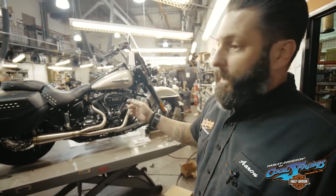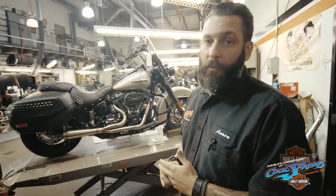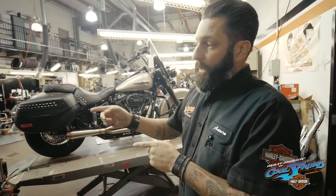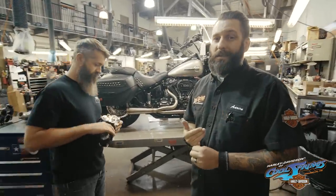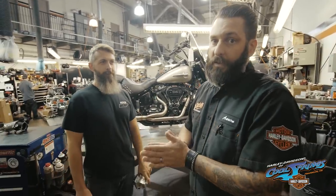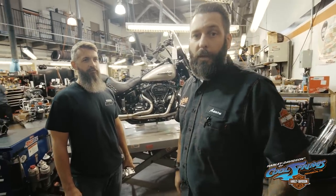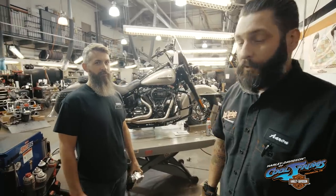Now if I were to take this pipe and put it on the bike that's sitting in the dyno room, that would not fly — not even close. Might look cool, but it's just not going to work. That bike sitting in the dyno is a 117 cubic inch, high compression build with the ported HPI intake on it, Branch and O'Keefe cylinder heads, and that one has an RB Racing two inch primary, two and a half collector, extended collector pipe that we had custom built specifically to work with that platform on that bike, because we knew what it was going to demand. Keep in mind: the exhaust systems that usually look cool don't perform. Trust your parts specialist to help guide you into the exhaust that's going to be best for your bike. You'll appreciate it when you're riding.